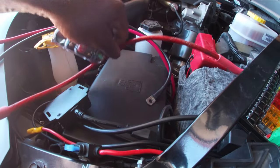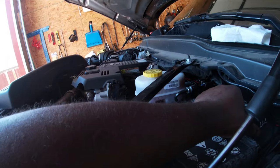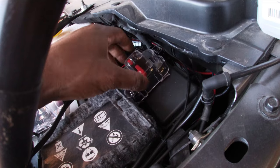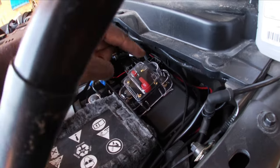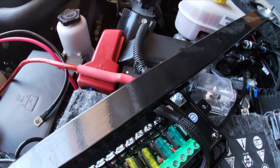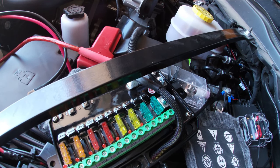I created a new longer power wire because the other one was too short. I want to mount it back here using double-sided sticky tape. This is normally where your auxiliary fuses or PTO would go inside that box, but since we don't have that, double-sided tape works. We'll run the power wire this way, come around, and connect to power here, then run from here to the box.